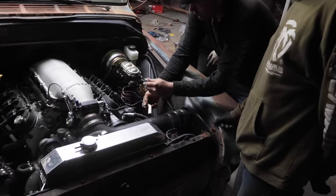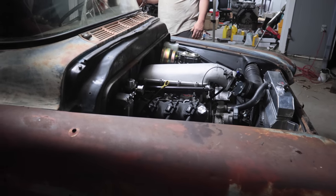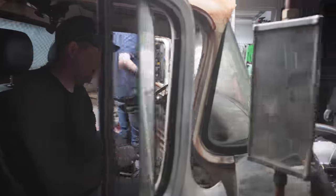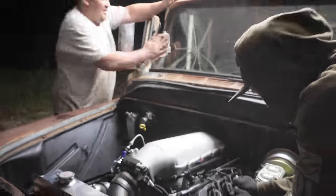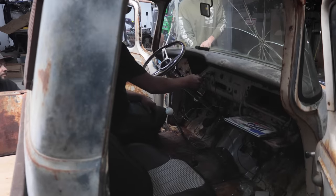Tune got reset. Think so? Oh, I know why. Because when I turn my key, it cuts the power. It's not getting everything it needs. No. I bet you that's it. It's not seeing RPM. Spark. Okay. Plug the injector back in again. Do this. Okay. I only heard that once.